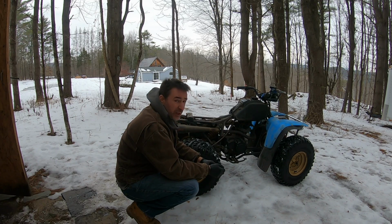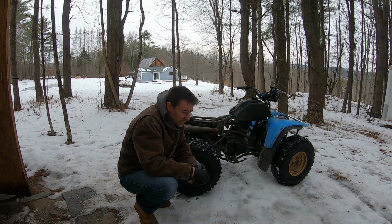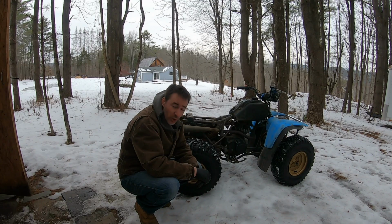Alright, well that didn't go anywhere near according to plan. So what I've ended up with is a larger pilot jet. I went from a 2.0 to a 2.25. The aftermarket Chinese carb that I bought, I couldn't get it dialed in.